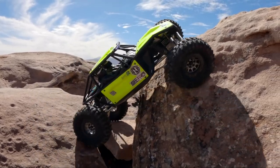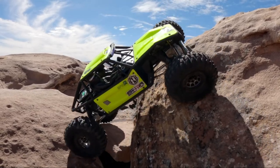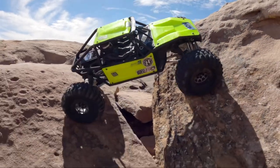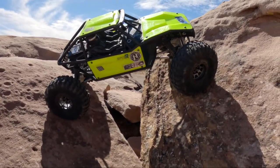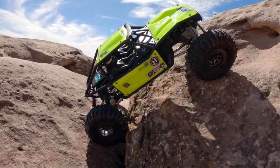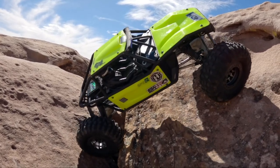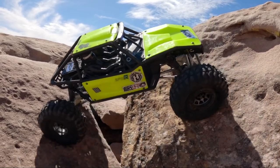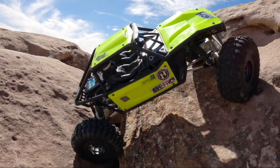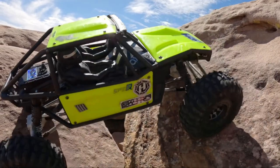Not quite finding the line to get up this one — this is pretty wicked. The clicking we're hearing is my dig unit. I've got my end points set to try and not burn up the servo, so they're a little conservative. It's not engaging tight enough, so it allows the dig unit to slip under extreme binding. There we go — should work right there.